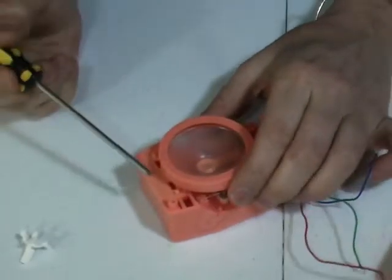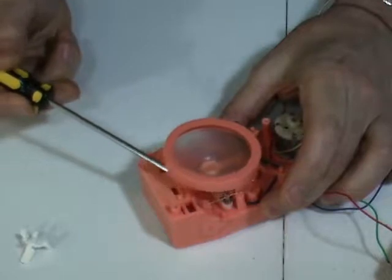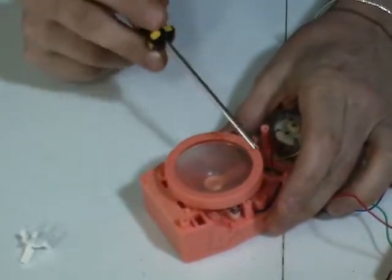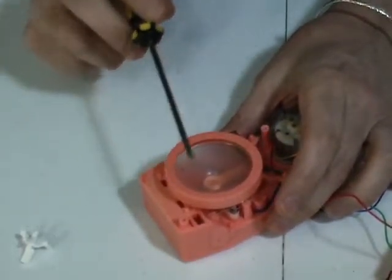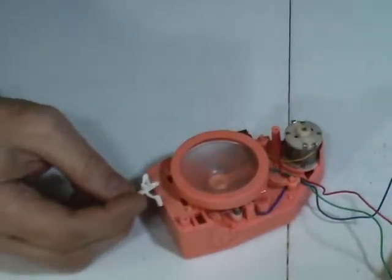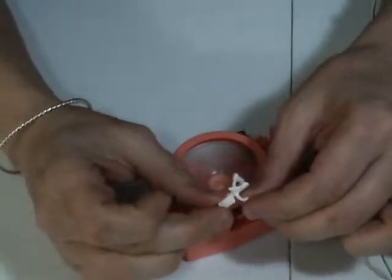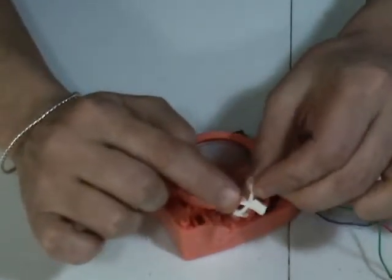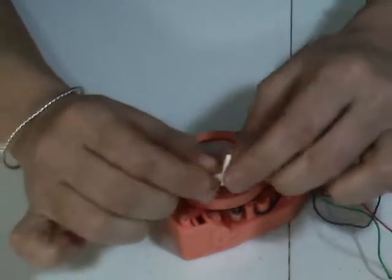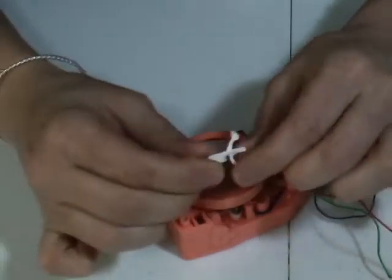As I've shown before, to make this thing activate, you lift up this diaphragm, which makes the spring-loaded needle go back to the beginning of the record. And the little device that you push on to make it do that broke. So I 3D printed this one, and I had to glue this little piece. Printed out in 2 pieces, then I glued it together. And so there it is.